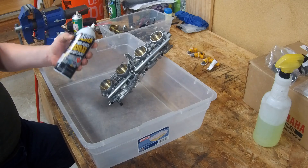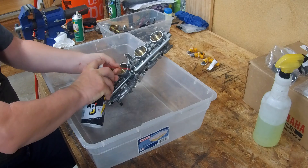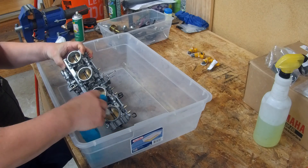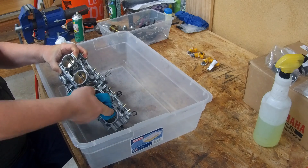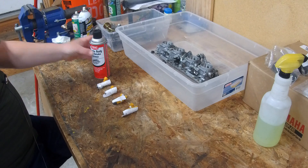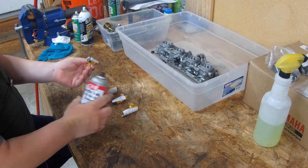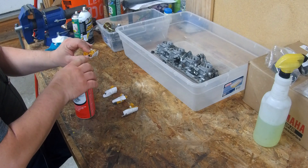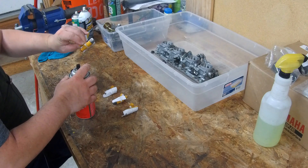Other than that it looks great. Next I'm going to be spraying all the metal joints with a multipurpose lubricant. Now that the lubricant has sat for a little while we can wipe off any excess residue. Now I'm going to clean each injector with throttle body cleaner — I'm going to be spraying onto the end and into the inlet, and just clean the overall body.